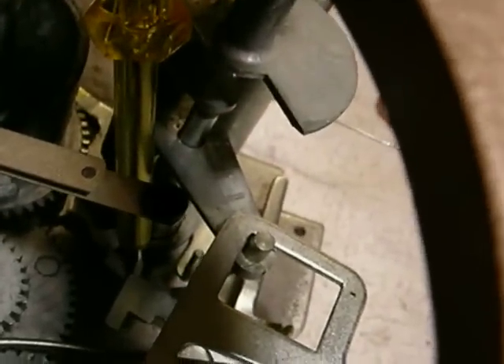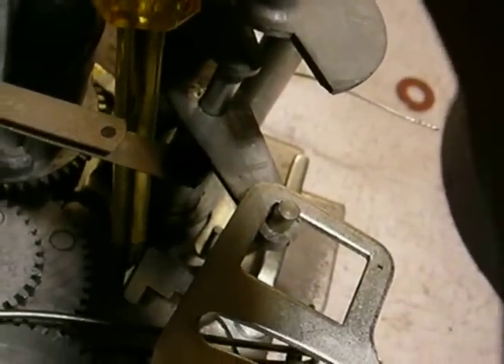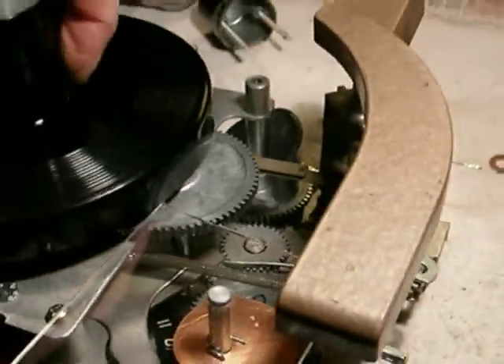That lifting part isn't in here because it's part of the top frame. When it finishes doing that, there's a foot on the bottom of the recycling cam — on the recycling arms — a little foot that when it gets down there it kicks a little lever right there, and it kicks this out. That shifts the gear assembly frontwards again into the main cam, and then that lets the arm finish the cycle.